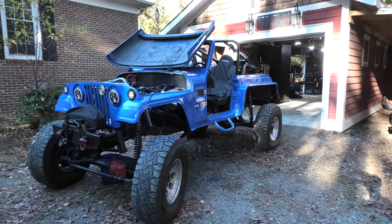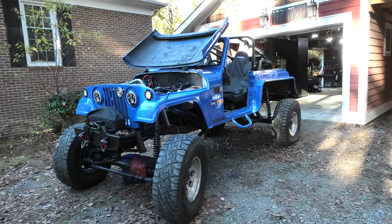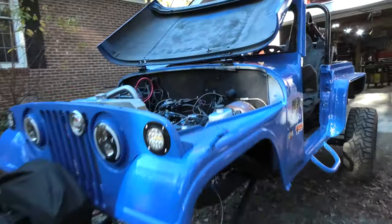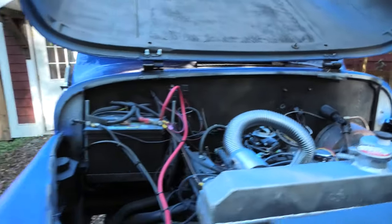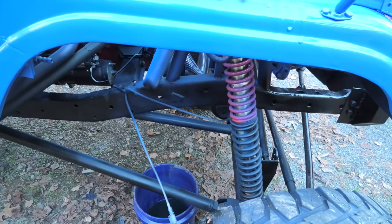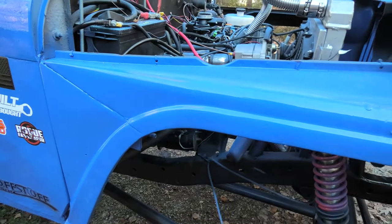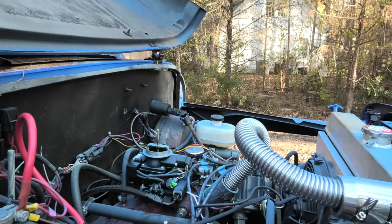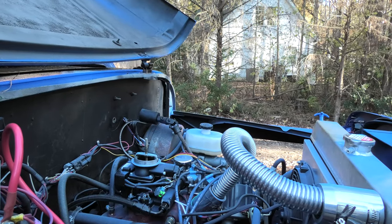There's the commando real quick. We are still troubleshooting why it doesn't want to idle. Just tested the fuel pump itself — I pulled the fuel line off, ran the pump, and filled up a bucket full of fuel. So I know for a fact that it is getting plenty of pressure going from the fuel tank up into the Holley where it needs to go. So I don't know what's up with the Holley. I'll have to dig into that and figure out why it doesn't want to run. But that is an ongoing thing.